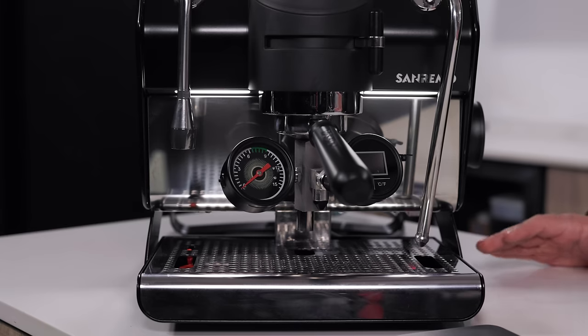This pump is supposed to respond in direct relation to the pressure, the back pressure of the puck itself. If we've set a pressure at 9 bar to go down to 6 to go back up to 9, if it goes to 6 and then it loses a lot of resistance and the original flow rate that did work no longer works to hit that 9 bar again, then the flow rate should go up. If it's communicating with the group, the pump, which is capable of more flow rate, should increase the flow rate to hit 9 bar until obviously it can't continue increasing flow rate.